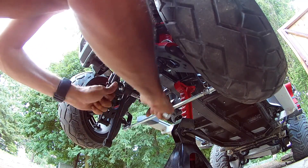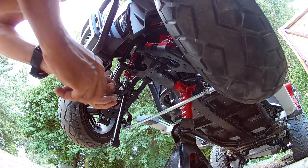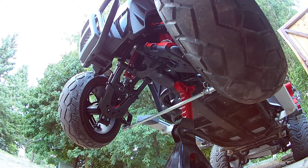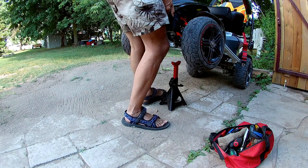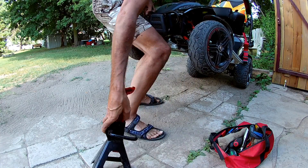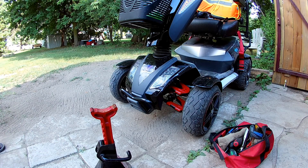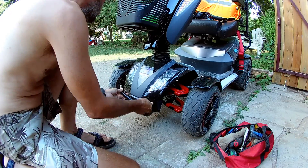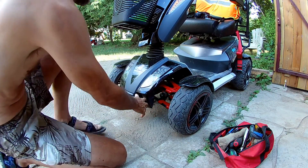At this point I'm going to take the bar out completely so I can set the scooter down on the ground and see how it reacts. What just happened is as soon as the weight went on the suspension, both springs compressed. The wheels went from pointing inwards to pointing outwards and actually slid sideways during that process.